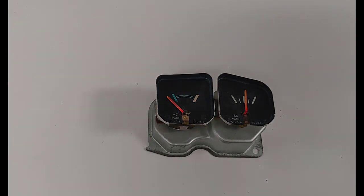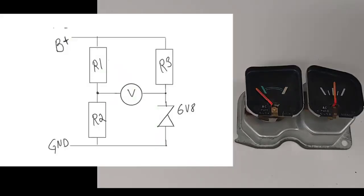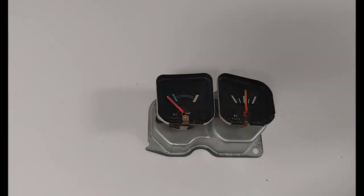My dream was to convert the ammeter to a voltmeter, something like this, but the 0.3 ohm internal resistance will clamp the bridge difference to 0, no matter what the battery voltage is. So my ammeter will stay there unconnected, just a decorative placeholder.